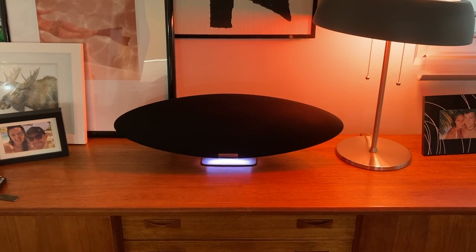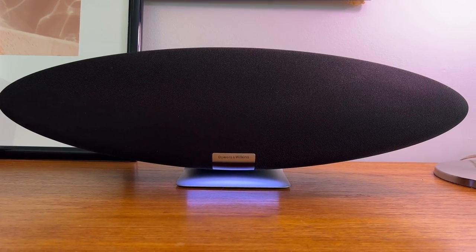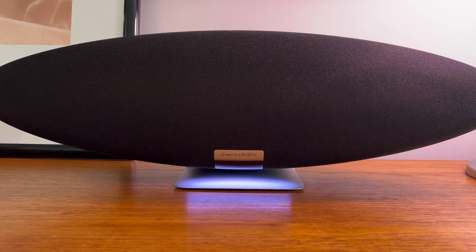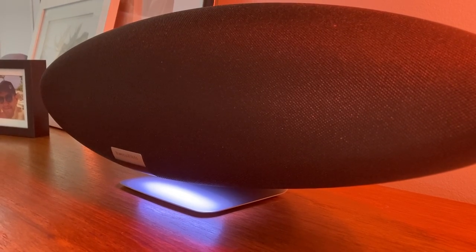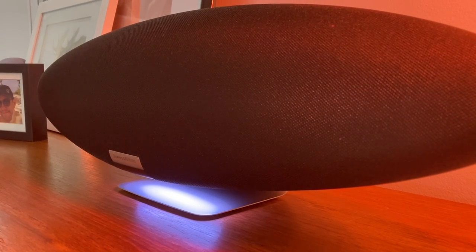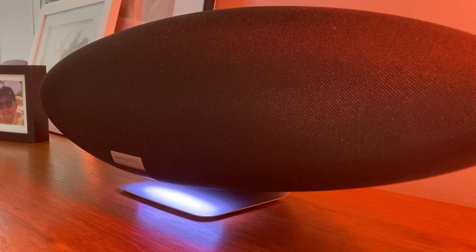It's AC powered, but it can play music wirelessly using Bluetooth or AirPlay. It may be important to point out that this is a big and heavy speaker, so you'll want a special stable place to show it off. It weighs about six and a half kilos or 14 and a half pounds. For those looking for the details, there are two 25mm double dome tweeters, two 90mm mid-range speakers, and one 150mm or six-inch subwoofer inside.